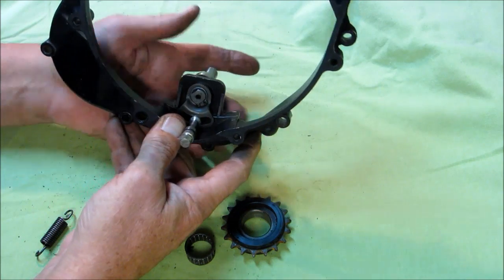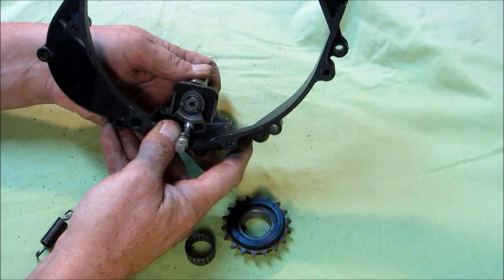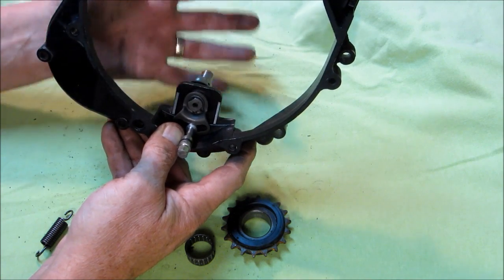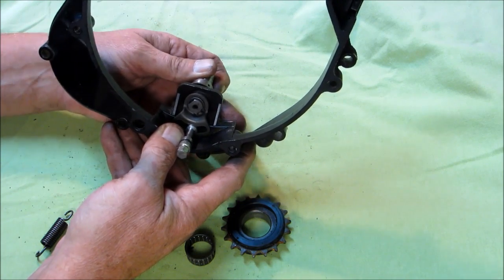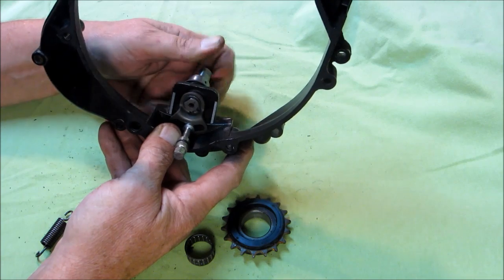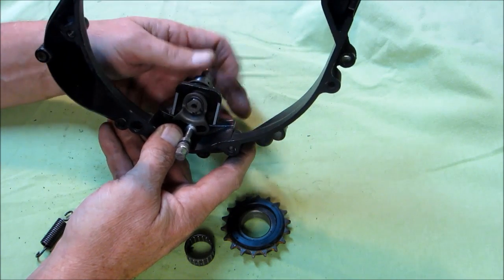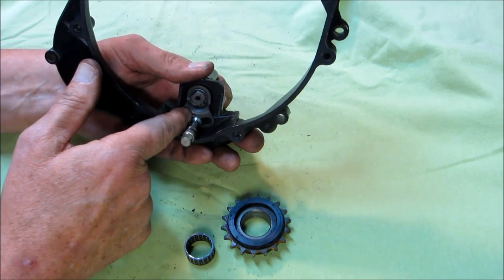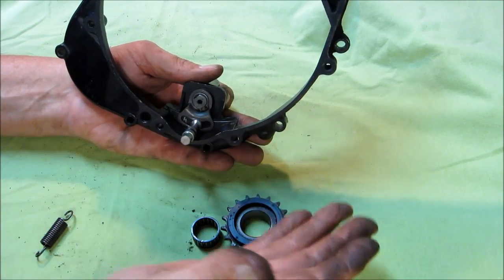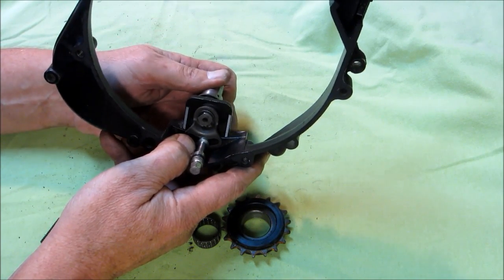But another thing that goes on here — I'm going to pull on this lever as the spring would — and if you look at this part of the shaft, you can see that it is free to wiggle. And the direction that it's wiggling in actually is un-tensioning the chain. So since it's un-tensioning the chain, it can sit there and vibrate. Now we've got this part of the doohickey snugged down solidly to the case, but yet this thing can sit here and vibrate thousands of times a minute. And over the course of 10,000 miles or something, that vibration is enough to break the doohickey. That's why they broke — one from over-tensioning, and the other from the fact that this was not a very substantial part and this thing can vibrate like crazy as the engine's running.